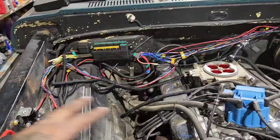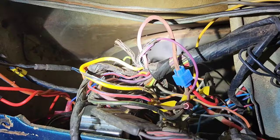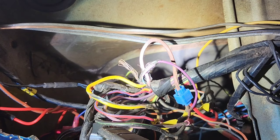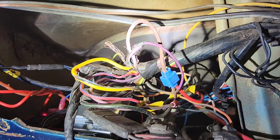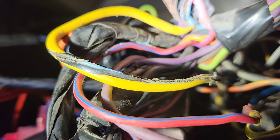I'm done with the red one. This one I was supposed to get the hood back on yesterday, so right now I'm going to clean up the wiring. Now that I'm not going to add or take anything away from it, I'm going to re-loom all of this and get everything ready for the hood to go back on. While working on the inside, I've had a short in here for the whole duration I've been working on this truck — a problem with running stuff on the key 12-volt — because it seems like they're always on. I finally took the time to unwrap all the tape to find what I was looking for.